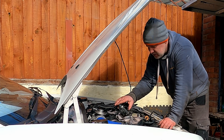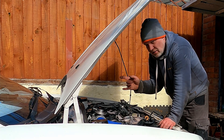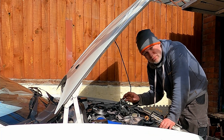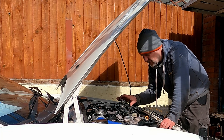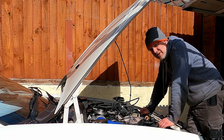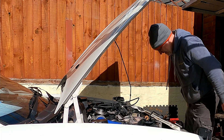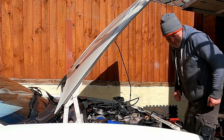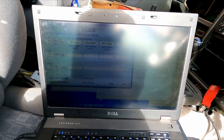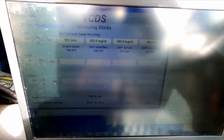I've had a good mess around. I've swapped over the N18 valve. I've gone through two EGR solenoids, and the N75 — which is the turbo one — can be used as a tester since it's very similar, different colour being the only real difference in specs. None of them were working, so I think I might have a bit of an electrical issue. Let me delve a little deeper — break out the multimeters. I've had a mess around, checked the wiring, swapped solenoid valves over, and it's suddenly working for no apparent reason.